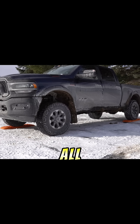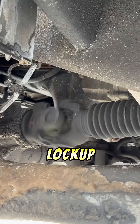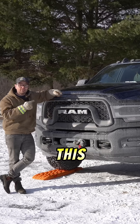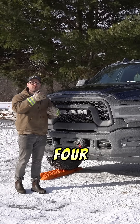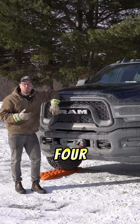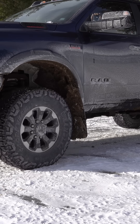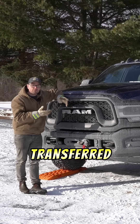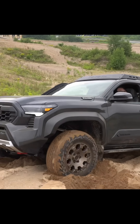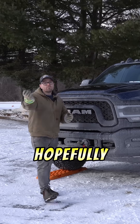Two wheels spinning, not all four. We didn't see any more wheels spin, we didn't see the front axle lock up, we didn't see more torque proportionally coming to the front axle — because a traditional transfer case like this splits power 50-50 in four-wheel drive high as well as four-wheel drive low. There isn't any magic off-road power with four-wheel drive low. It is simply a torque multiplier. Our wheels actually spun quite a bit slower, which is exactly what four-wheel drive low does — it allows more torque to be transferred to the wheels, thus a slower spinning wheel, potentially giving us more control and access to the traction we already have.